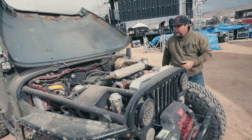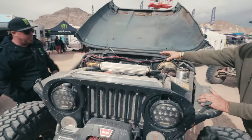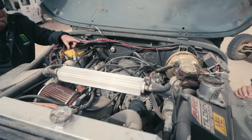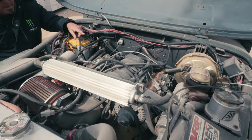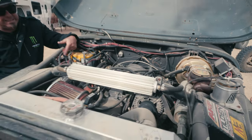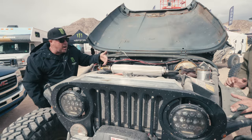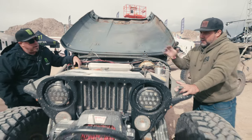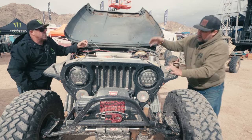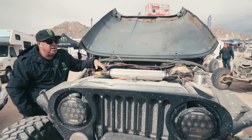Full hood — I really wanted to keep it as CJ-ish as possible. So I sent it out to LS Garage in Sacramento and Jordy put a six-liter cast block in it. So it has an LQ9 block — no longer an aluminum block. It's basically an LS6 with a six-liter cast block, car intake, car accessory drive. It's all Corvette and she's a mild 450 on the dyno.